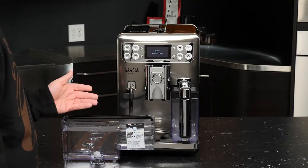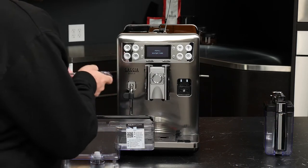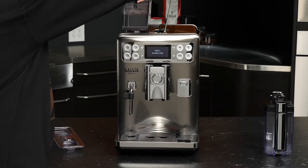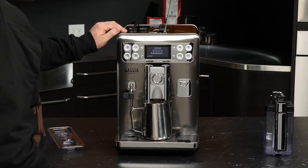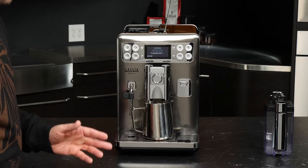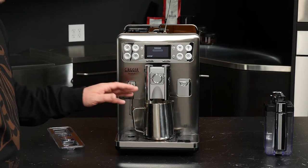Now we have our water reservoir filled so we can continue with this process. I'm going to do just a couple of things in advance. We'll remove the carafe — I won't be needing that right now — and fit this little socket cover tab in there, just like a puzzle piece. Now we can go ahead and put the reservoir back in the machine. You'll need a nice container to get under these spouts, as it's going to run a rinse — drawing water in for its initial prime, which gets the water circuit full so it can pump for your espresso. Your machine should be clear with all the water that comes out.